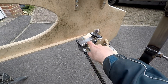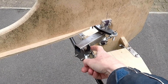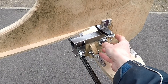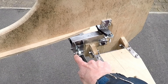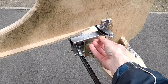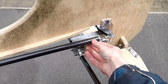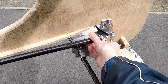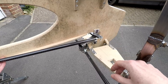The first bit to point out is the steel bell crank mechanism that I've finished. This is welded up from square section steel tube with a bit of plate welded top and bottom. We've got a 6mm rod end bearing, 8mm here, with the misalignment spacers fitted to give the angle of articulation. This one only has to move like that so it doesn't need the misalignment spacers. This is a left-hand thread here so I've made these left-hand M6 nuts, locking nuts, and the steering arm — remember to turn it the opposite direction. The steering arm screws onto here and is locked in place by that locking nut. So there's going to be two steering rods, one left and one right.